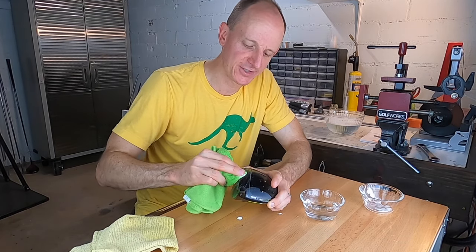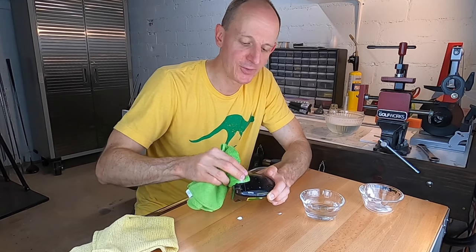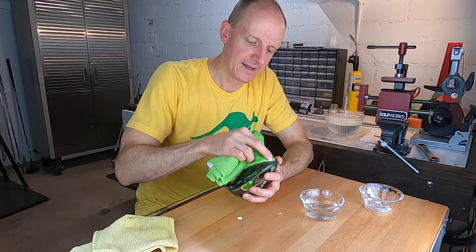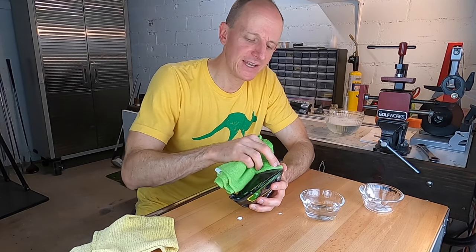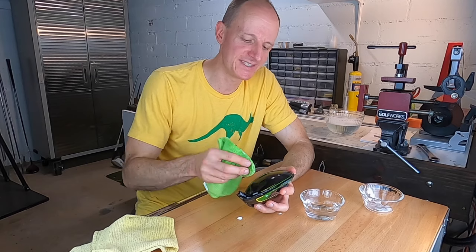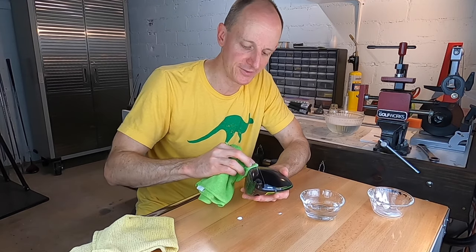Let's get a little more toothpaste and try to work deeper into some of these scratches — just smooth them down a little bit. With deeper scratches, the best you can do with this method is smooth down those sharp edges and hopefully lessen the appearance. There are other things we could do, like touch-up paint, for a more elaborate fix. As for toothpaste type — I think paste works better than gel, similar to the old advice for fixing scratched CDs, though in a pinch the gel would probably do a very similar job.